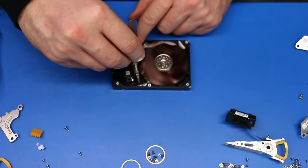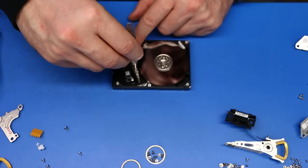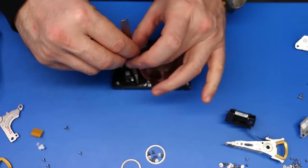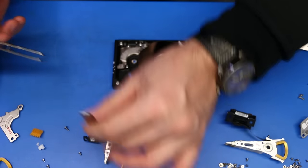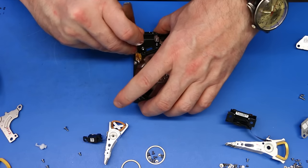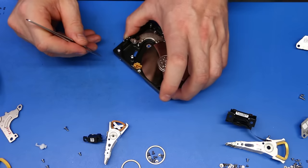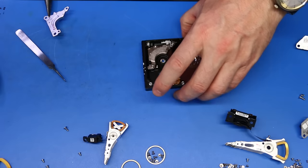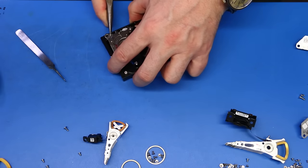At HDD Recovery Services we do not reuse heads after they've been released on stuck head drives. It's a small cost saving, but it could have tremendous consequences if things go wrong. If the head assembly survived the release, it's best to verify that on a donor and then repurpose that donor for other work if those heads are working. Taking a gamble on the patient's drive who is paying you to get this done is not the right way to go. We use working confirmed heads from donor devices to replace the originals.